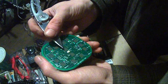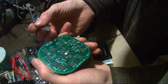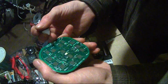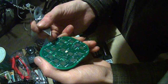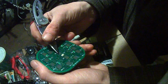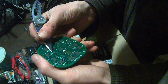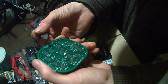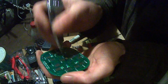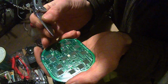say if I were to scratch way over here first, without being sure of my technique, I could easily wind up cutting off all of my ability to contact here and wind up having to go somewhere along the traces, which somewhere out here would be a better spot if I've screwed up here. I want to go here. Ooh, I almost messed up and nailed my board with a knife.